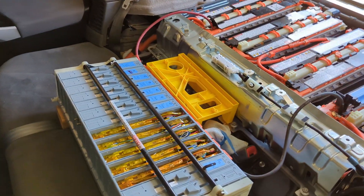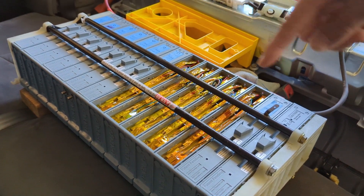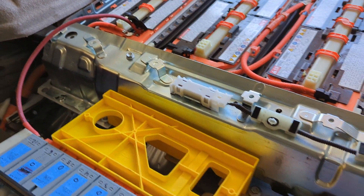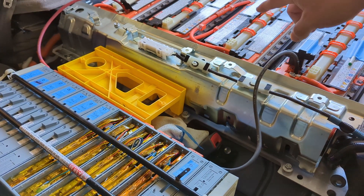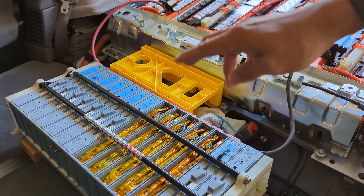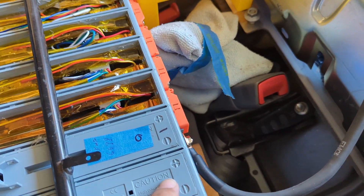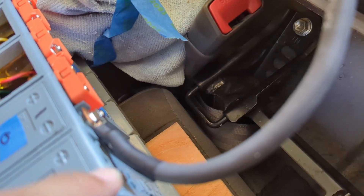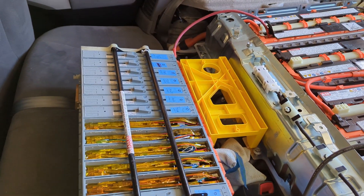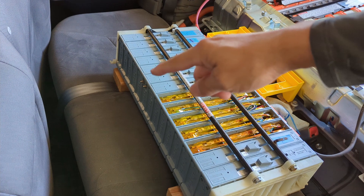Here's another angle for the piggyback system. I haven't connected the service plug yet, so the circuit is not complete. I do have the negative to negative here and positive on that side — two different systems. This one is iron phosphate chemistry; this is a different chemistry. The two are running in parallel at the same voltage range. The first one is actually not connected at all — it's an empty case. We actually have a total of 13 next-cell lithium blade cells right here to match the voltage from the stock. Exact match. So let's connect the service plug and get the show running.